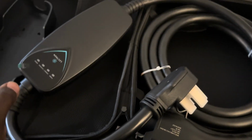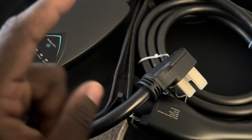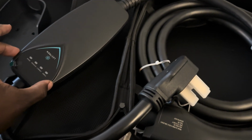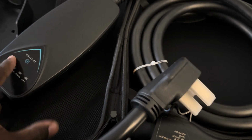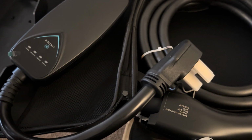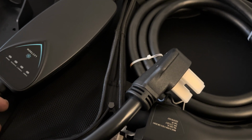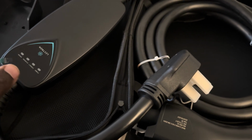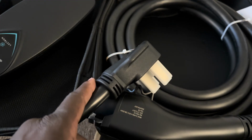and there's no way to take this plug off. My Cadillac charger comes with this exact same plug, but it also comes with a removable piece that allows you to plug this into a regular 110 volt socket. So it seems to me that if you have a portable charger, you'd want something that would allow you the flexibility of going to a 110 volt or a NEMA 14-50.